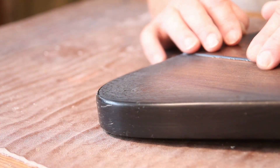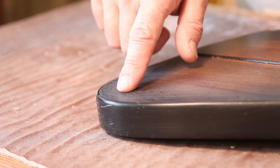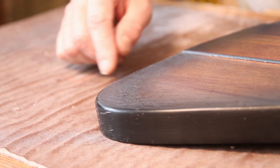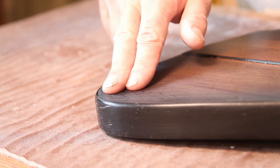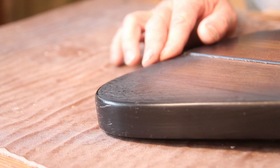I've been over most of this now with the 600 grit on the block. You might be able to see here that it's flatted down most of it, but there are still some little uneven patches — shown up as shiny spots in the more milky area where we've rubbed down. I don't really want to rub this down on the block until I get rid of all of that, because I might take one of these edges off. You've got to be very, very careful on your edges.